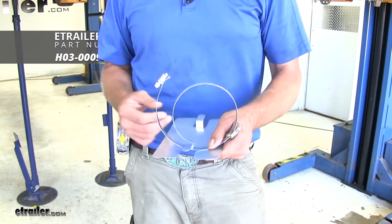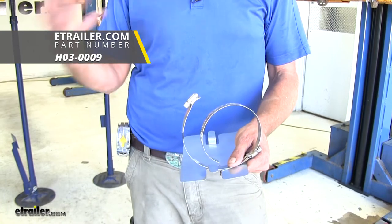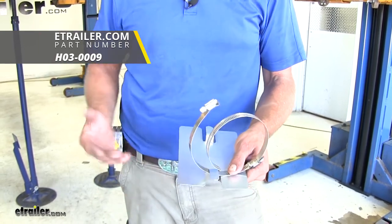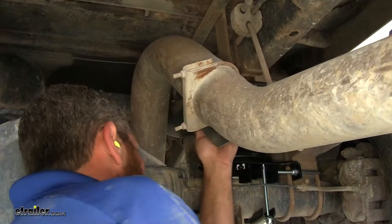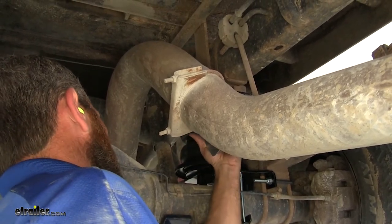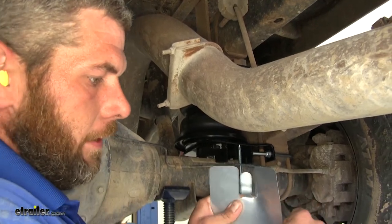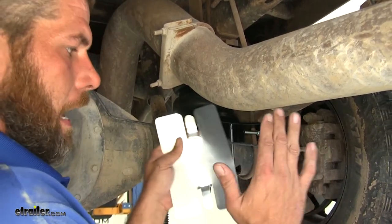What we've done is combined an additional 4-inch clamp with those. For your standard exhaust, the one that comes with the kit should be fine. In this case with the giant exhaust, we need to add some length to the hose clamp — you can choose to get one longer one or add two shorter ones, whatever your preference. We just want to bring that up in position, and with this larger exhaust we need to make a few modifications — flex it so it contours with the exhaust.